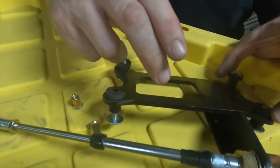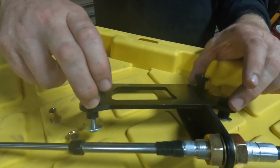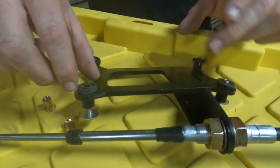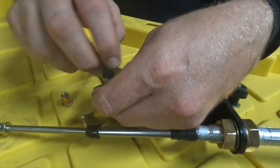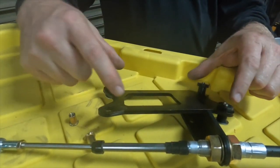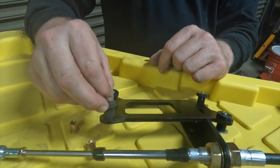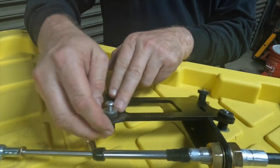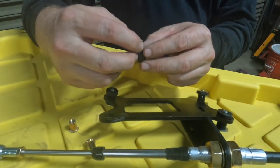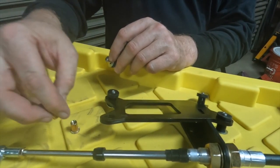So I really had no idea that that bracket had come free, because all I saw was the tops of the bolts and I couldn't see the nuts underneath. So I had no idea that those nuts had disappeared. So before we put this in place, we may look at alternatives to attaching it. Now, there's a lot of options into how we could do this. The way this actually works, this comes from the tunnel side. So you put that in, the bolt comes from this direction, and it expands inside this hole to hold it in place. We could potentially do a nutsert.